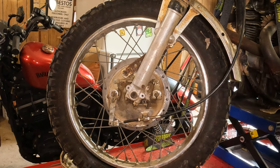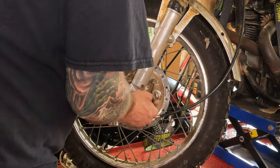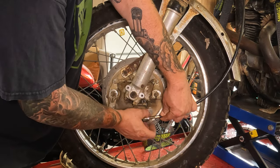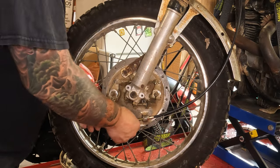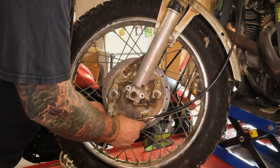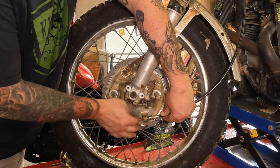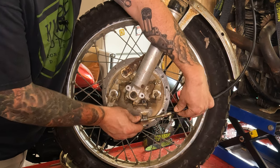After that, we're gonna loosen up our adjusters and remove the front brake cable. It's gonna take a 14 millimeter and a 12 millimeter. You should be able to just break these two nuts free. Break these two nuts free and spin the one on your right all the way back — that will let your lever go all the way forward. Then undo it here. You may or may not have to take out a little cotter pin, which this one's missing. Push the lever forward and slide the cable straight down. Unthread your jam nut all the way off, and you should be able to slide the cable right out of that notch.